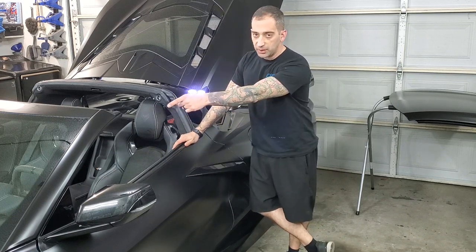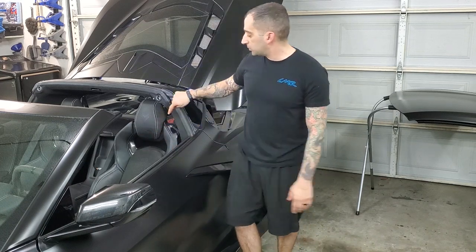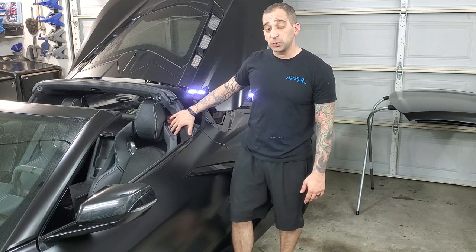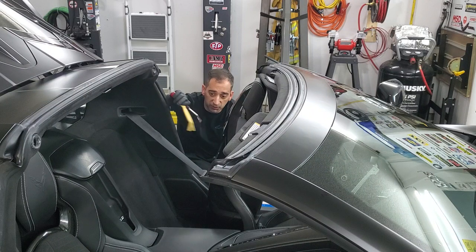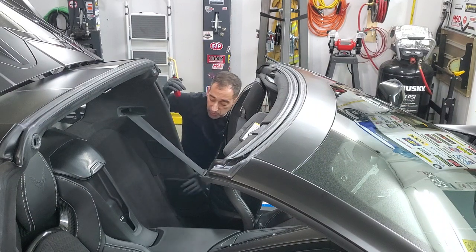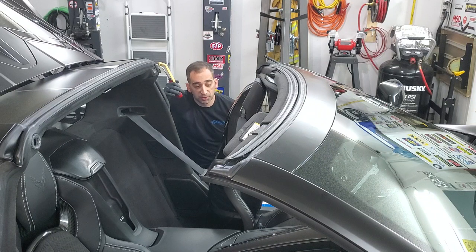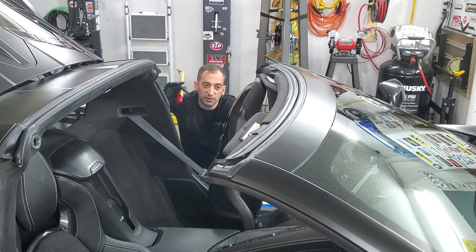If I say firewall, I'm talking about that wall. So the first thing I'm going to do is get to the pass-through, which is near the back of your seat by the firewall back there. You'll need to remove some stuff inside to get to it. There's basically a master connector on each side that goes through the firewall into the engine compartment — one is tucked down in the corner on this side, with a mirrored one on the passenger side. You have to get this carpet out, and some trim pieces out to get that carpet up and out of the way. Move your seat forward all the way up; if you want to take the seat out of the car it will make things a lot easier, but I'm going to leave the seat in to show it can be done.